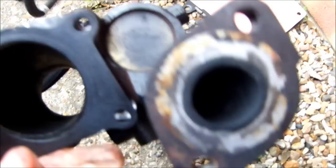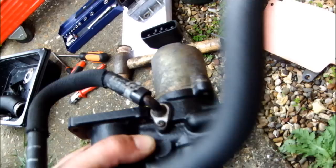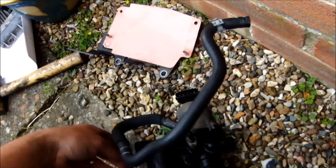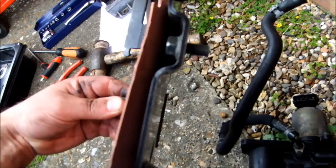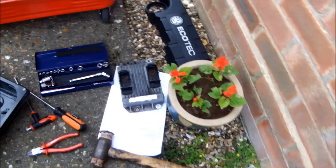Spent a lot of time cleaning that up. Used some carb cleaner at the end to get rid of any final residue. There are three little cap head screws holding the solenoid on — they are a nightmare to get at, so I'm going to try to put it back together with that part already attached. This is the ECU plate. There's an insulating paper gasket — be very careful, it's easy to damage. There are also insulators on the threaded parts of the studs where the ECU mounts, and an earth cable goes straight on there.